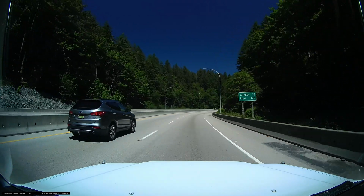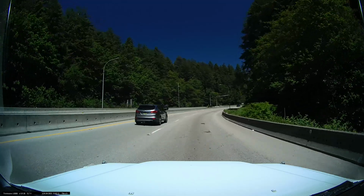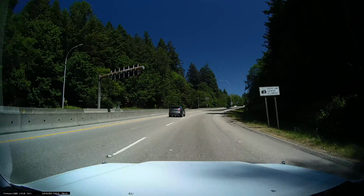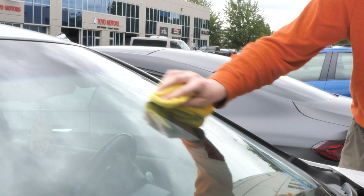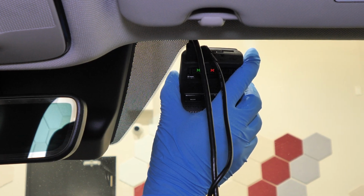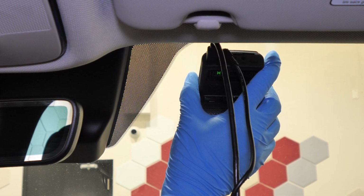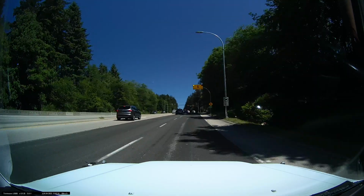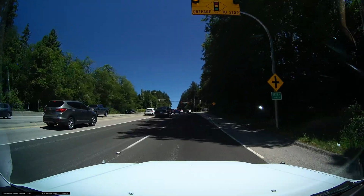Now, how does the footage look like? Next thing we're going to dive into is the dashcam's video capabilities. We want to make sure that it's recording and also clear and focused. Your dashcam's lens serve as your eyes on the road, so you want to make sure that it has a 20/20 vision. Make sure that the lens are focused and none of the objects in its vision are blurry. Try out a few different angles to make sure it's not just your windshield's angle. Looking from the outside, make sure the camera lens are clear. No cracks, condensation, smudging, or anything that might affect your dashcam's view.